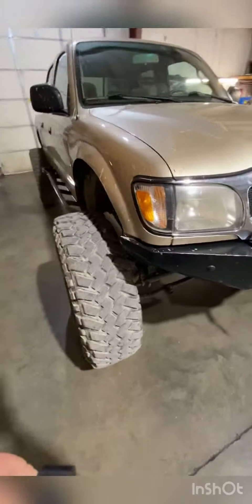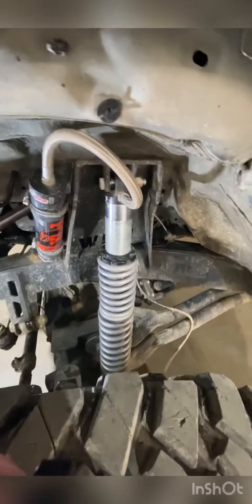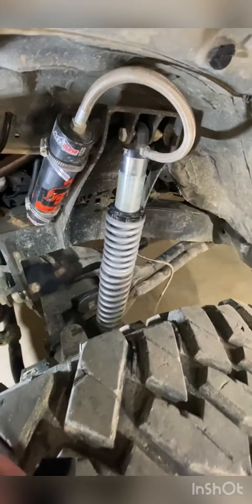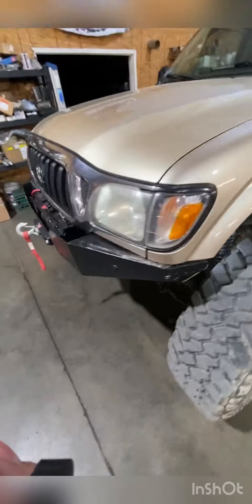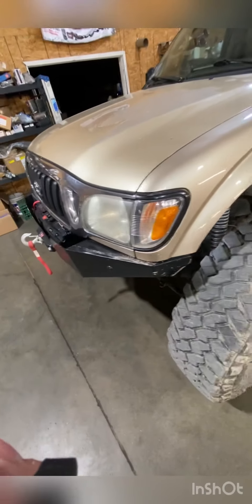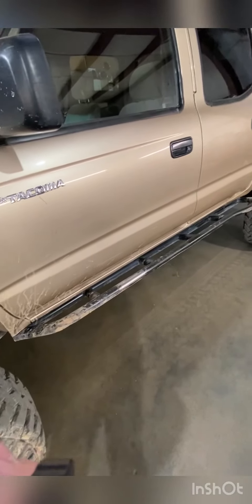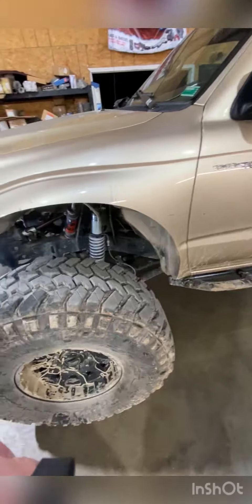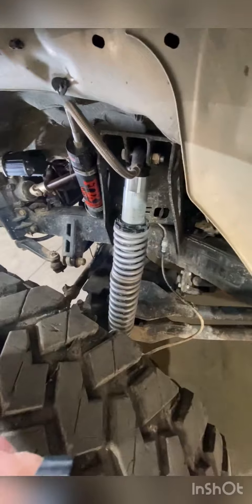Here's the truck at ride height. As you can see, I've got my preload set a little tight on the coilovers, which I figured would happen because my spring rates were a little low. Since I set up the truck I've added the bumper I built, my winch, and whatnot, so it's weighted down a little more than I anticipated. The sliders are probably pulling it down a little too. I'm in the works of putting stiffer springs top and bottom on the coilover, and right about there we're going to have a bump stop.